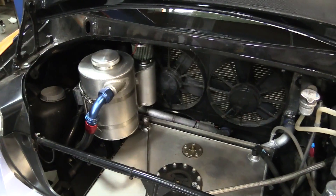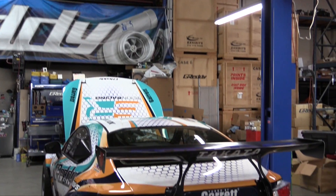Given the opportunity to revisit Pikes Peak next year with more development, is there anything particular you would change? The team would want to focus on improving the aero package and definitely the way the cooling was ducted. Currently there's no ducting, and improving the cooling ability of the car and getting a bit more aero would probably help out. We really want to try to break that 10-minute mark and those will be the keys.